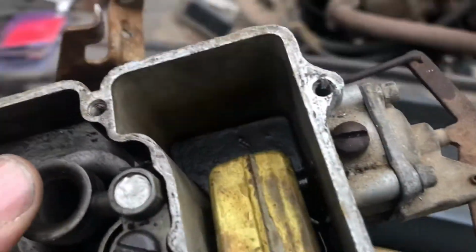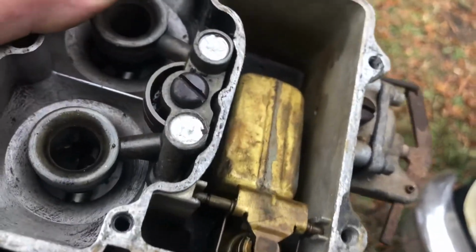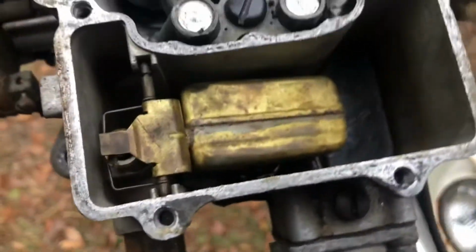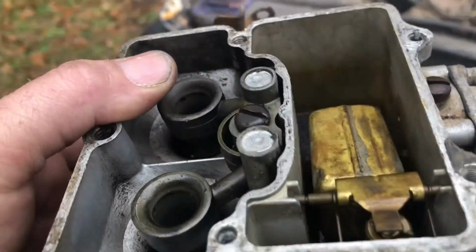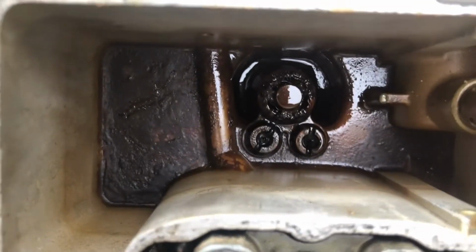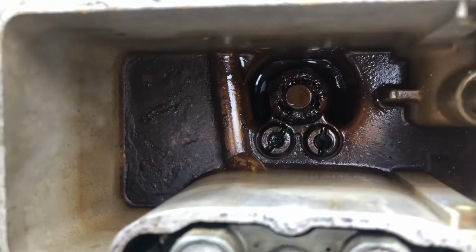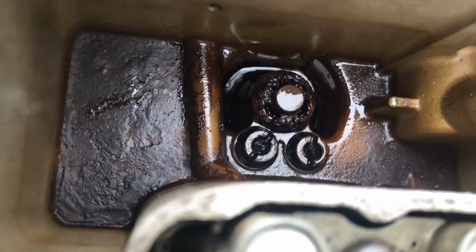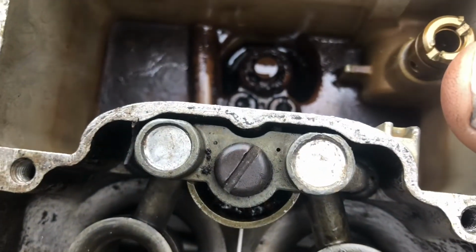I don't know if you can quite see it, but there's some crust in the bottom of this thing. It looks like month-old Cheerios. So let's see if some of that might have some stoppage going on here. I would say these jets are more stopped up than pruned out at the retirement home, but we will see. I'm gonna get in there and pull these out and run some carb cleaner through them and see if we can't get this thing just to move around a little bit.